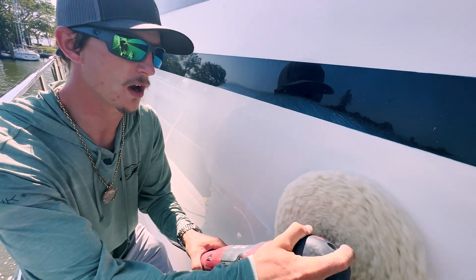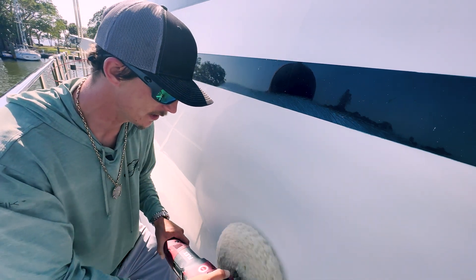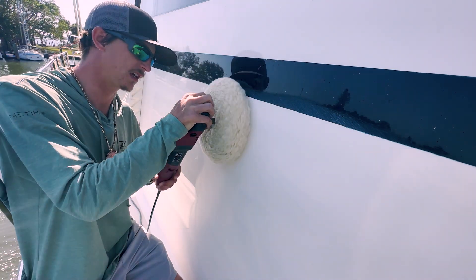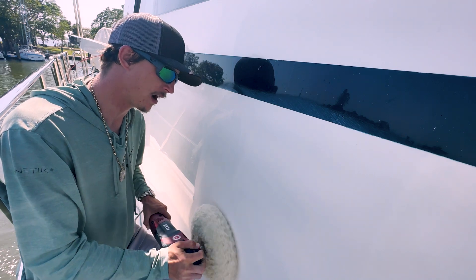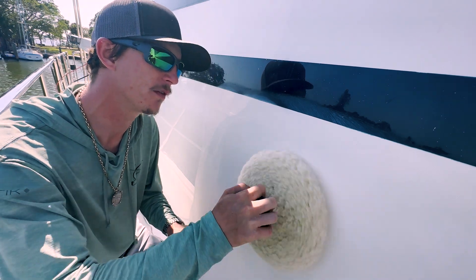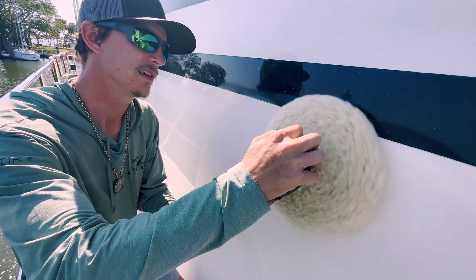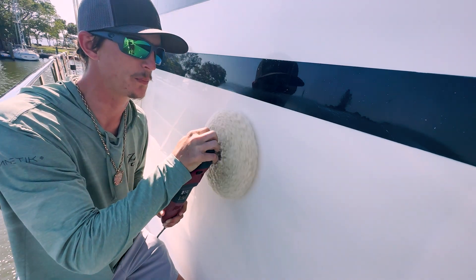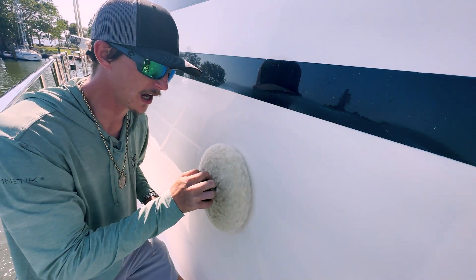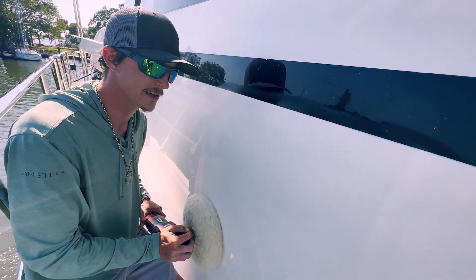All of those lines are going left to right because the pipes sitting in this location were blocking the sun from hitting those areas. So I'm going to dig really hard on my left-to-right passes, hoping to take those out nicely. Still on speed one, still digging really hard — probably at a seven on the pressure meter. It is paint, so you've got to be mindful of that. After about two solid passes, I'm going to bump it up to two, slow my movement down, and let the spin take control. I came down to a five on pressure — really just controlling the machine, letting the pad and product do the work. You can already see a pretty wicked gloss.